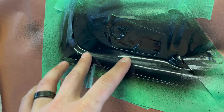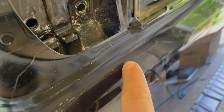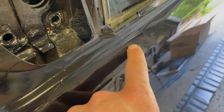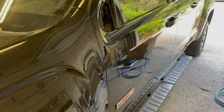That's probably five coats of paint and four coats of clear. There's no denying it's bad — it's fish-eyed, there's a hard tape line. Fortunately most of it is going to be covered by the mirror. I let it dry for about half an hour, and in a few days I'm going to come back and try to blend that tape line in a little more with the mirror on. But this is a massive improvement and it's going to save that door.